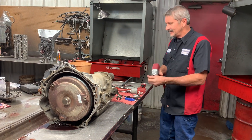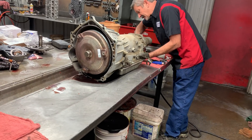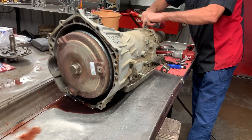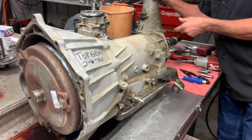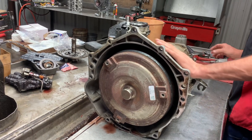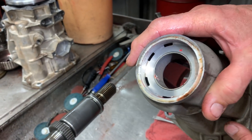I'm excited to see what type of damage we have. Maybe it's been rebuilt before. It's a 2005 model, so it's going to have an input speed sensor and all that type of stuff. This has been rebuilt before — I don't know by who — but if you come here and look at this old bushing right here, that's a factory GM bushing in this tail housing.